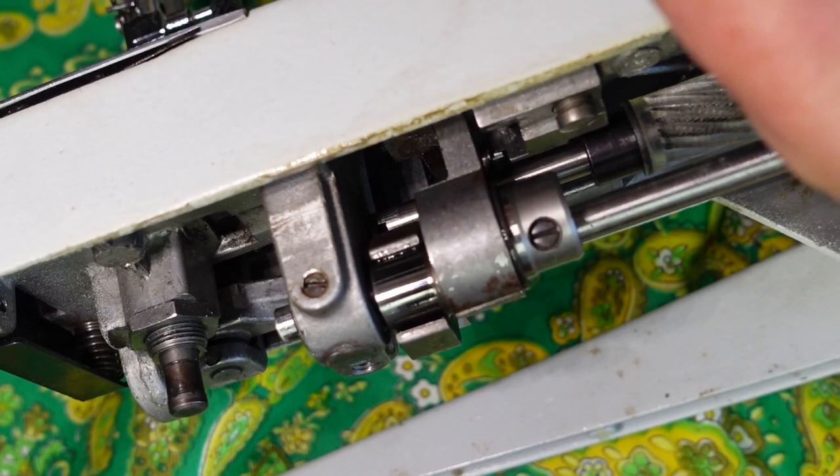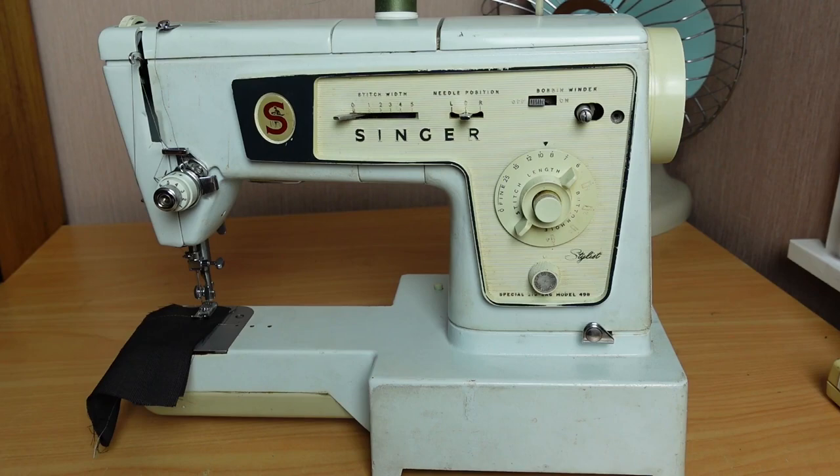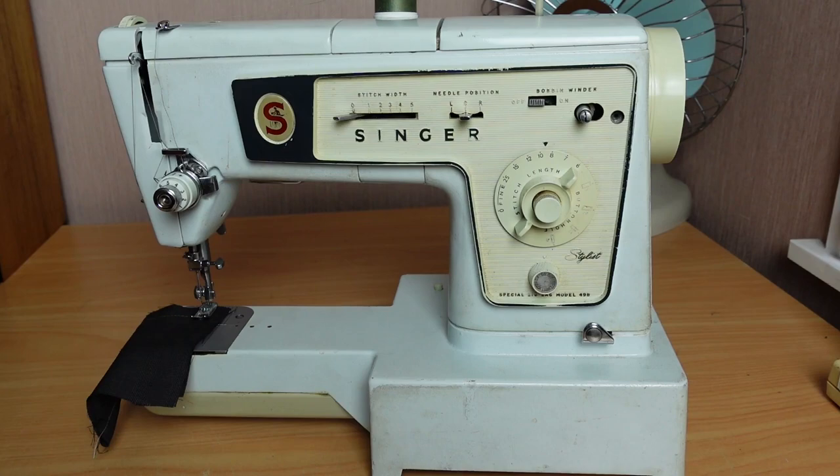There's another hinge here and another linkage right down in there — pretty hard to get on camera, but you'll see the other end of that rod as you turn the machine. I'm going to leave it at this stage, because the brand new feed gears are now installed and the machine is ready to have the hook timing reset. You can reinstall the original hook drive gears or go ahead and put in new ones at this point. Then we set the hook timing — keep an eye out for the next video where I'll go through that — and then the video after that will be the feed timing. Thank you as always to my patrons on Patreon, and thank you all out there on YouTube or Odyssey for watching. I'll see you in the next video.